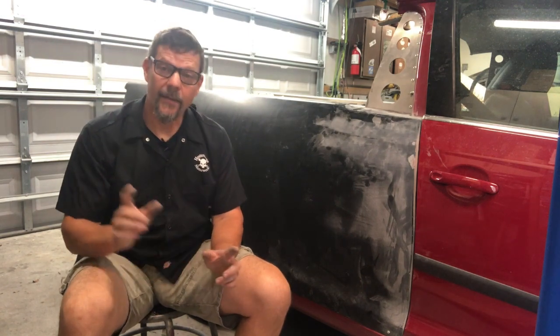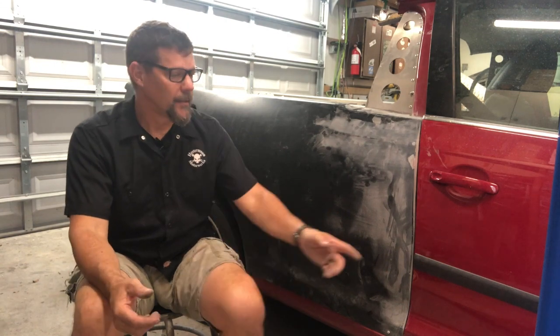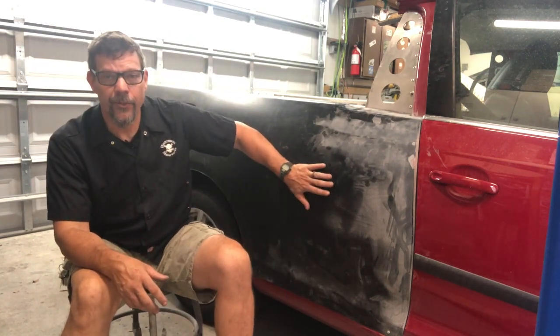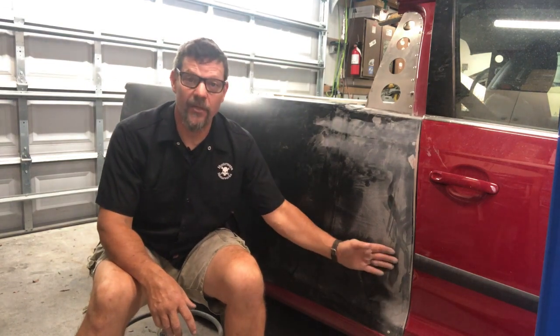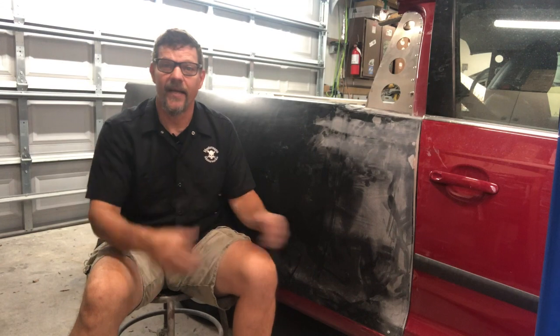An important decision is what you're going to do for sills. The Mark V Jetta comes with a full sill from Smith Performance, unlike the two-piece sill on the Mark IVs. Personally, I don't like the two-piece sill and usually order aftermarket rocker panels from eBay. If you cut off the sill that's molded into the rear quarter panel, it really helps it sit down properly and helps this line up at the bottom of the door — otherwise the door will always be inset from the fiberglass.